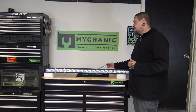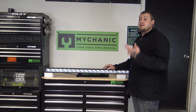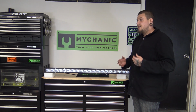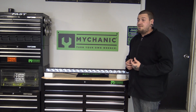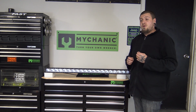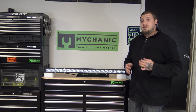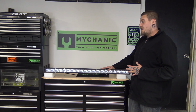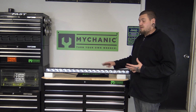It didn't come with any type of harness, which might be a good thing, because if it came with a harness like the previous quad row light bar that I did the review on, it's better that it didn't, because like I said in that video, and I'm going to say it in this video, that harness is just dangerous. The wiring is way too small, and it shouldn't be used to support anything more than 5 or 10 amps. So even if this thing is only a few watts, I would almost guarantee it's going to produce more than 5 or 10 amps, hopefully.